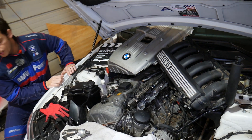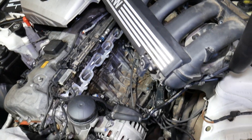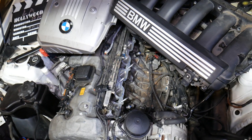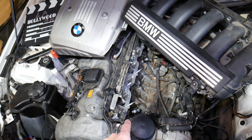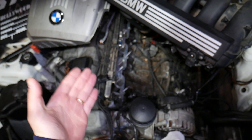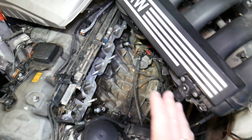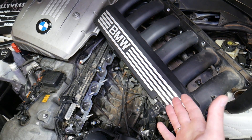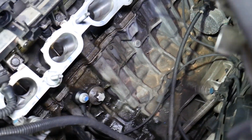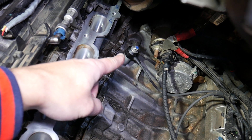This is the N52 gasoline engine. On a 6-cylinder engine you have two knock sensors, and on a V8 — which is very common in the X5 here in the US — you will have four knock sensors, two on each cylinder head. On the 6-cylinder, the knock sensors are located on the engine block. In both cases, V8 or 6-cylinder, you'll need to remove the intake manifold. On the 6-cylinder it's on the right side; on the V8 it's between the two cylinder heads. This device here is a knock sensor, and there's a second one — that's knock sensor bank 2.